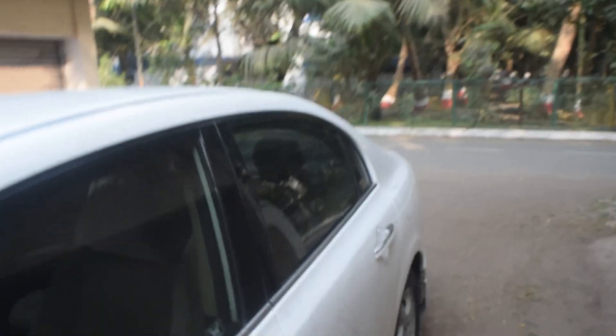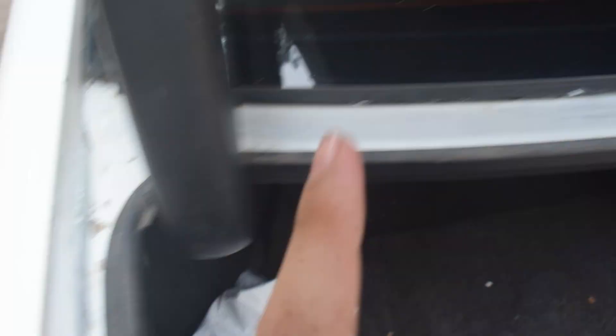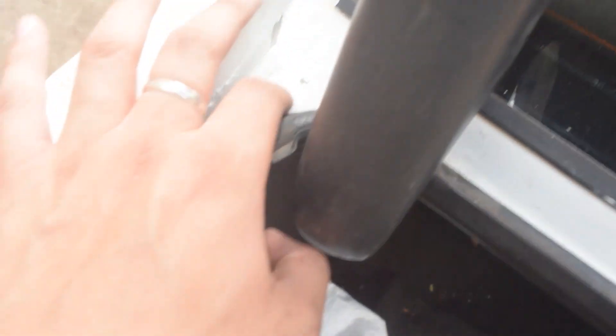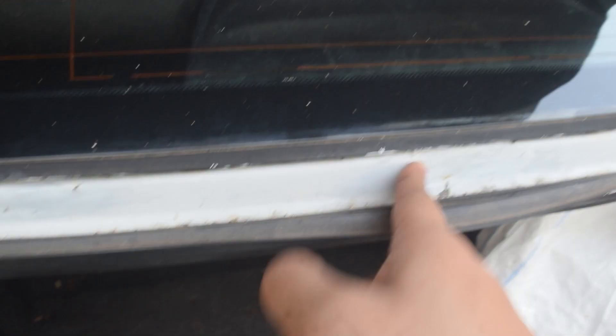There was also a new battery fitted. Let me open the boot and show you what I was doing there. As you can see it's freshly painted - in the monsoon I realized water was coming in. I thought the seal was the issue but when we took the seal off, there was basically a chunk of metal missing, so water was seeping in from below. There was also a hole in another spot which I've repaired.